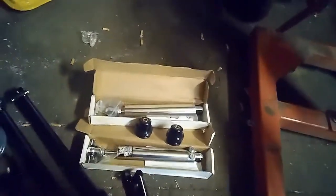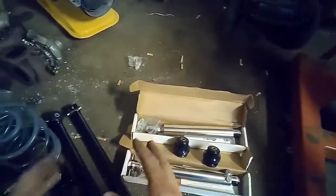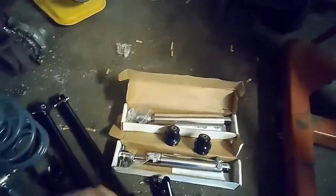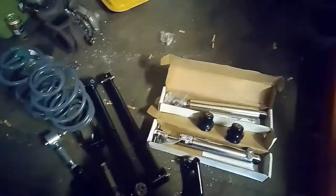It's not a coilover setup, but basically the same deal, double adjustable shock. So we'll crawl up under there, and they suggest replacing these one at a time so that you don't have to try and balance the axle. If you were to cut loose two of the uppers or two of the lowers, it's going to roll on you. So we'll cut loose one, replace the piece, the next, and next, and next, till we've got it all replaced with this shiny new stuff.